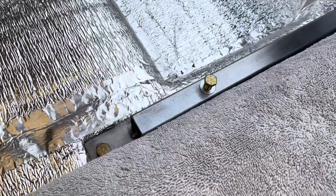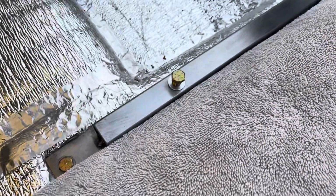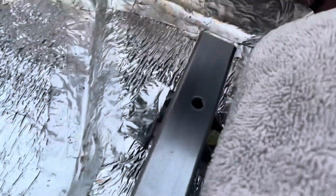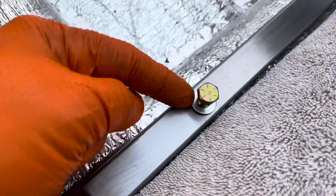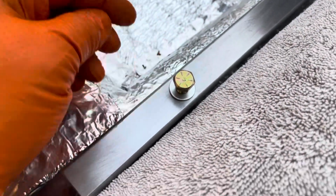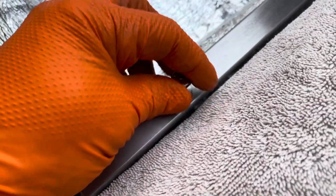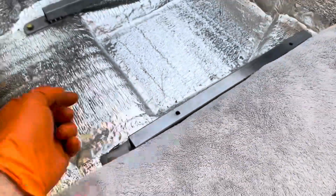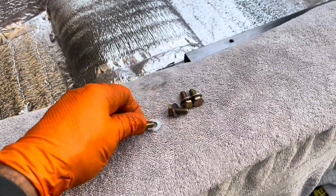All right, the final showdown. What I just did, I decided to do, you guys, is I went ahead and threaded these holes. Instead of putting bolts through, I decided I'm just going to put in some bolts from the top. That'll make it easy, and it's plenty strong. I used these 5/16 grade 8 bolts. It'll be fine. I'm not doing much with this seat except kind of fiddling around with the car, and it'll get replaced pretty soon. So I got these bolts.